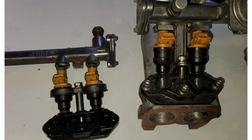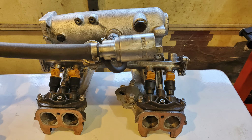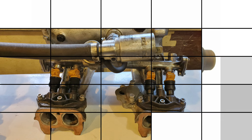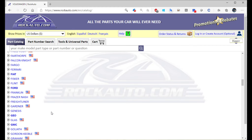With the 2.5, earlier I showed I built that using the Motronic 2-point fuel rail which was using a later EV1 style clip and seal injector. This type of injector has been used a lot over the years and in this case I was using them out of a 2000 Ford Mustang 4.6 liter, as the 4.6 liter Fords were using a Bosch style of an injection system.